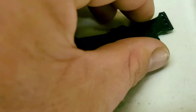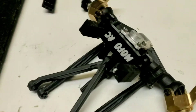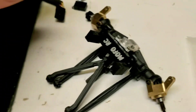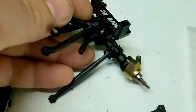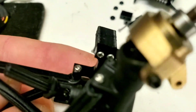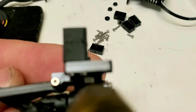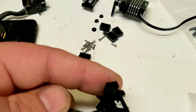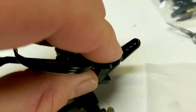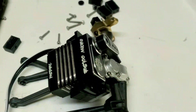This one is the four-link plate and this one is the three-link plate. I'll probably continue selling these just for the price factor — they're only about 11 bucks shipped. However, I do have the new Mofo RC aluminum mount, and one of the big differences between my mounts and everybody else's is mine are adjustable. The servo upright posts are very far back on this mount right now, but you can move them forward two or even three spots, or rearward one spot.